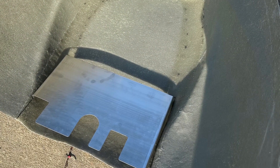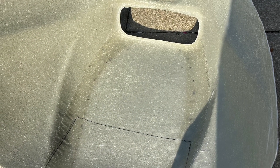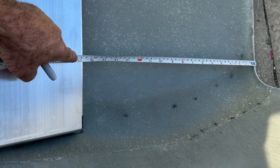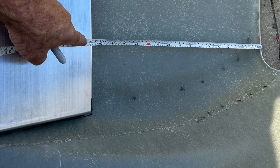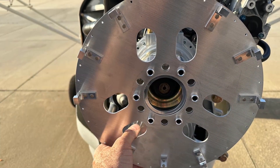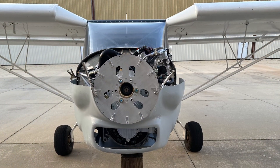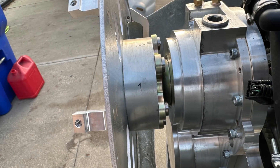We took the four screws out of this front baffle plate around the nose wheel and put it back in the cowling in order to mark the cutout that we need. We cut it out so the air can enter from underneath the cowling and go up onto the radiator. Here we're doing what we've shown in a lot of videos — the process of mounting a cowling step by step.